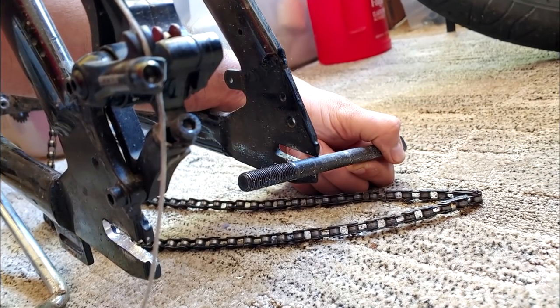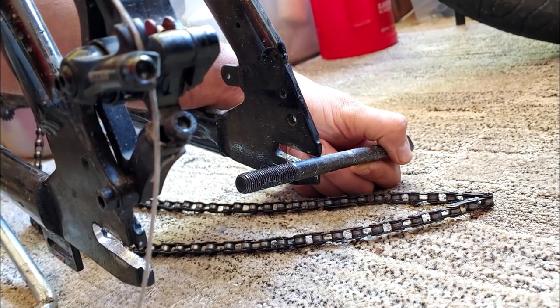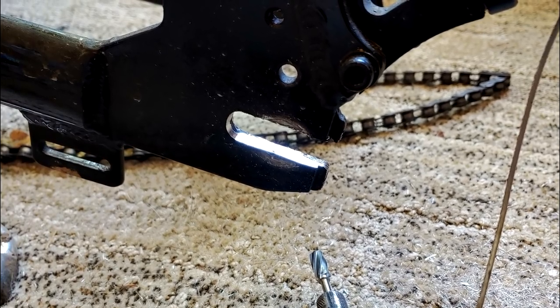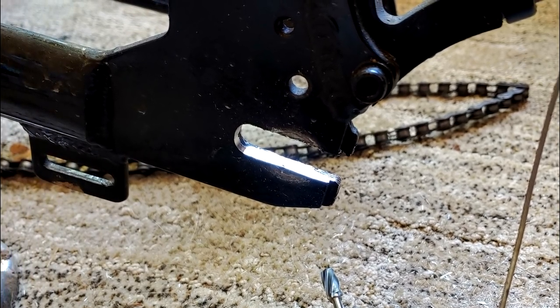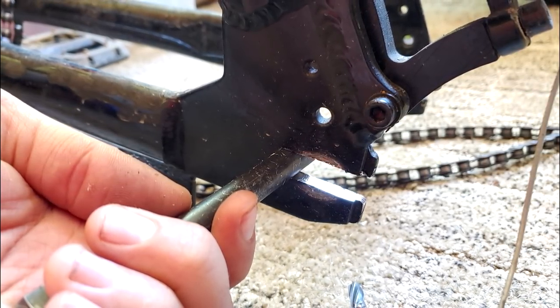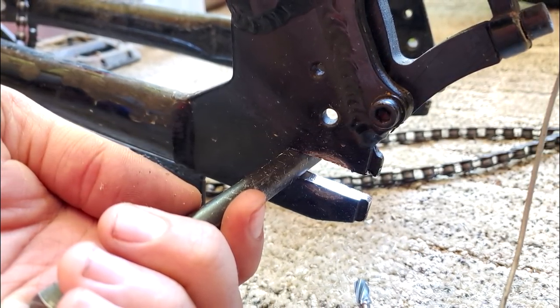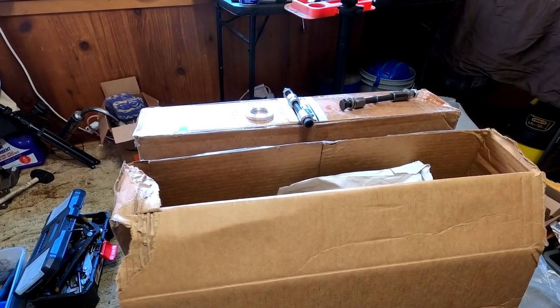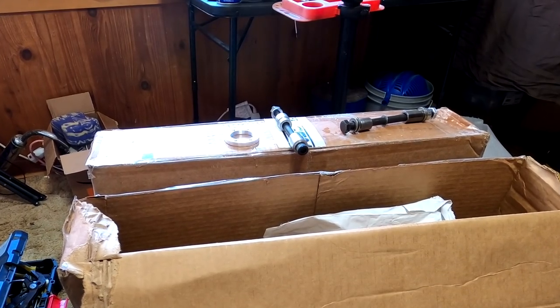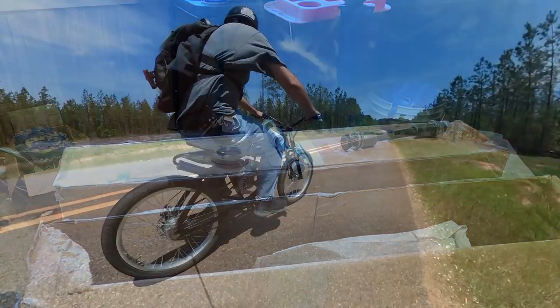Now, with the rear wheel using a thicker 12mm axle, do keep in mind that you'll probably have to shave a bit of material away from your rear dropouts to make them fit. Although it is deceptive, it was a very minimal amount of material that I removed from the top of the dropouts, so they would slide right in. The front wheel bearings are optimally designed for a 20mm through axle, but do include spacers to mount it to standard dropouts on cheaper forks.